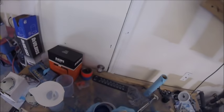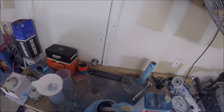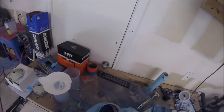I'm going to pull a filter out, a strainer. And I have a little bit of leftover paint. I'm going to shoot first, just to make sure my gun's shooting correctly and I don't have any issues like fish eyes. I was fighting fish eyes pretty bad on the trim pieces and whatnot. So I was going to shoot a little bit of this first on the panel and just see if I have any issues. If so, then I've got some extra reducer laying around that I can wipe that off and then figure out where my problem's coming from.